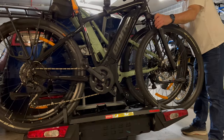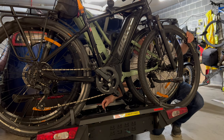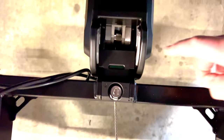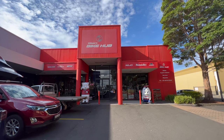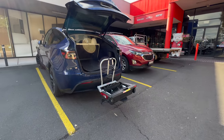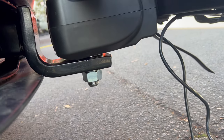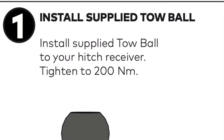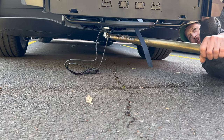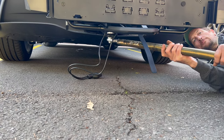There is still a rather alarming amount of free play of the rack sitting on top of the tow ball, so I investigated to make sure it was secure. It's locked, and I checked to make sure the indicator was green — not red — on the tow ball connector, which it is. I was bothered by all of this movement though, so I took the car with the rack back to Wilson's Bike Hub and asked their opinion. The technician had a close look and could see that the tow ball itself was actually moving. Apparently the manual says to tighten to 200 Newton meters, and clearly I hadn't done that. He got under the car with a large wrench and tightened the tow ball so there was no movement at all. Problem solved.